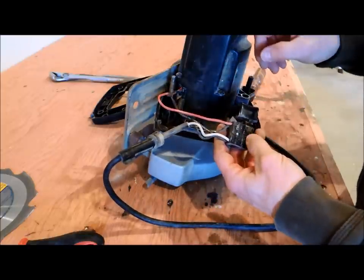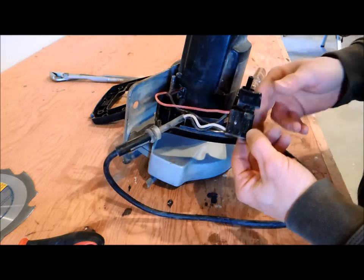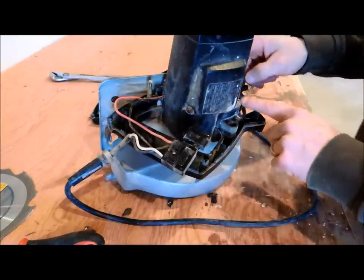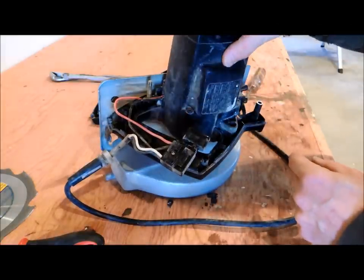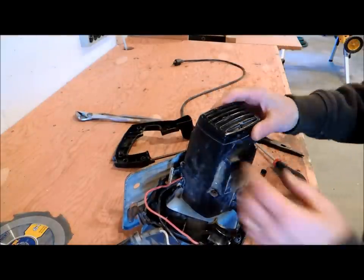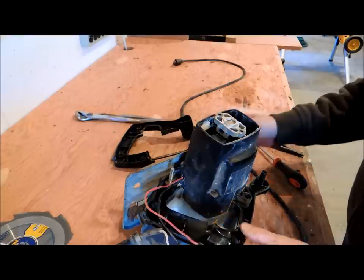In this case I'm going to take the motor apart anyway just to show you what's in there, so I'll probably save the cord and trigger assembly together. This motor housing part has Torx screws, so I'll do that off camera just not to waste your time, but I'll take that apart and pull the housing off. I had a sneaky suspicion the brushes would be under here.